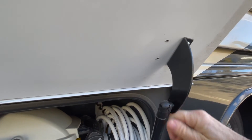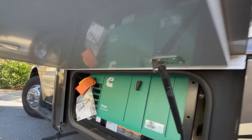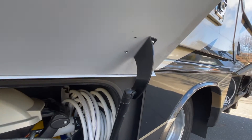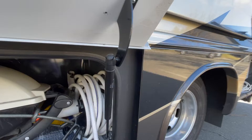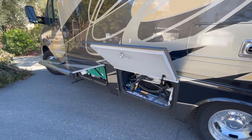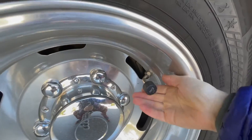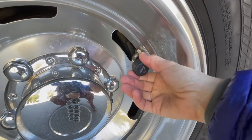It's one of those hydraulic gas spring hinges — you just have to be careful about which side and the way you put it on. Here's what it used to look like with the original hinge. This has worked out awesome — it opens up a lot higher now. Just have to be careful of the slide-out.